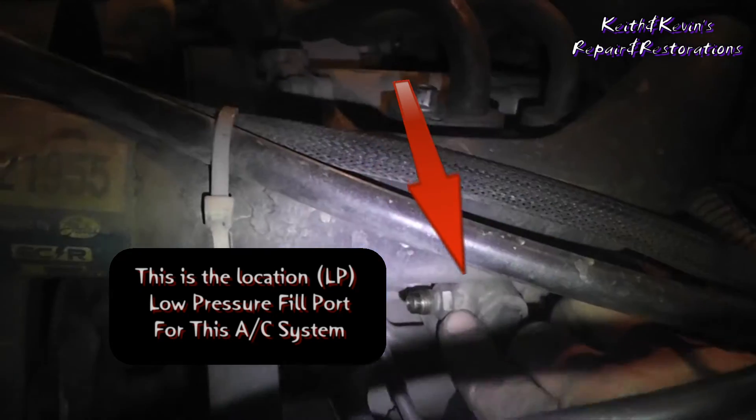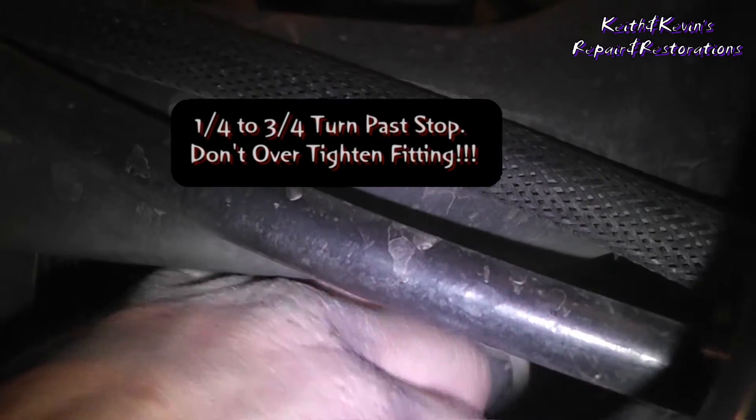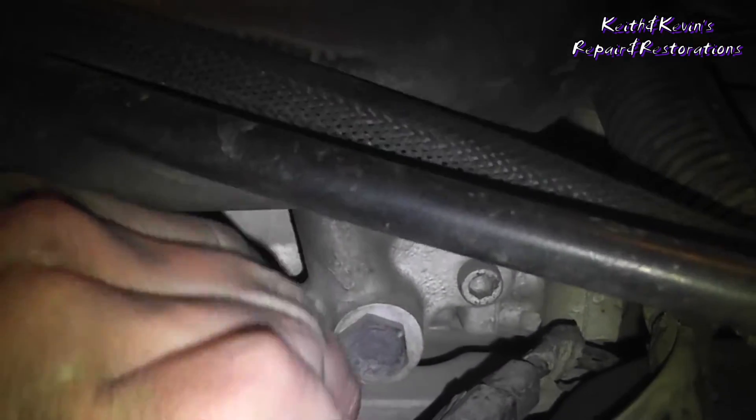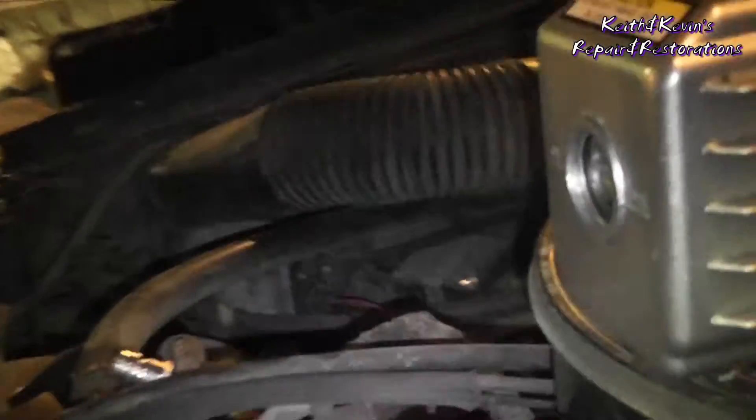Go ahead and start this neat little process — insert your first low pressure tip. You can't get this wrong because the low pressure fitting is different than the high pressure. It is in a very tight area. No need to over-tighten — about a quarter turn. There's Loctite on there and this thing will never come off. You'll replace the compressor before you ever take that clamp off again. There's the low side done — now do the high side.